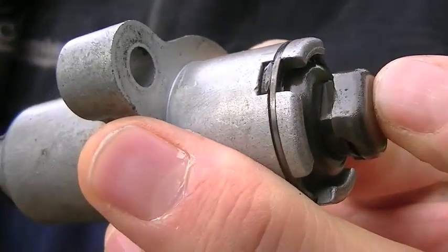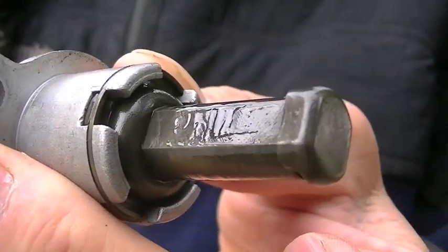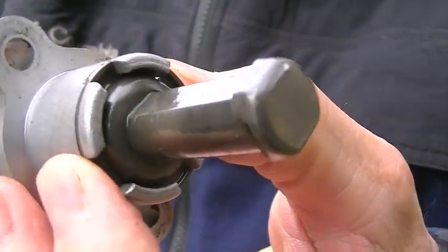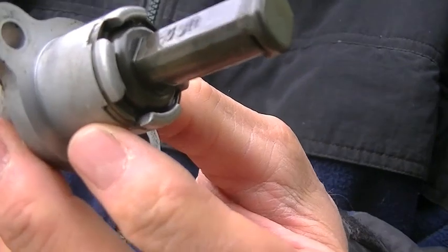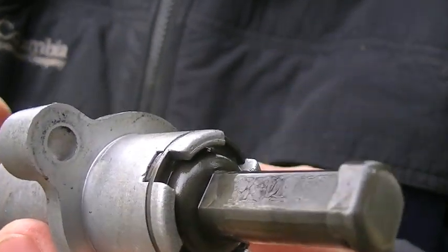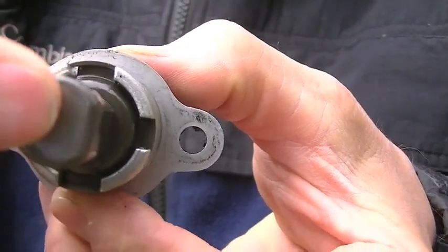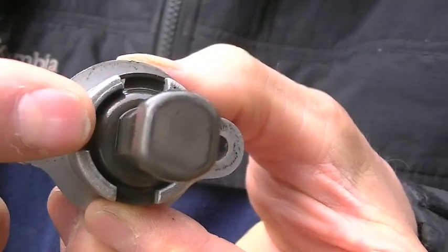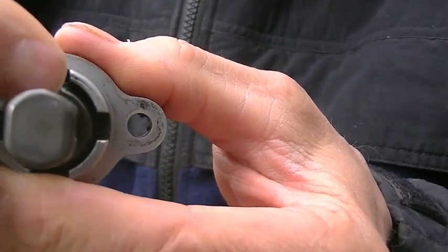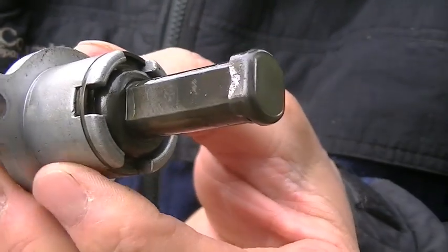When you release this screw, the thing just automatically pushes in. That spring-loaded tension against the cam chain is the purpose of this thing. So the difficulty in putting it back is that you have to screw it out, hold the screw in place, insert the cam chain tensioner with the plunger drawn back, and then once it's bolted down, you release it and the spring will go forward and put tension up against the chain.